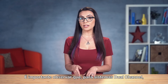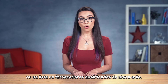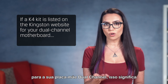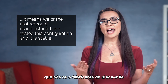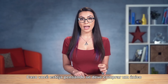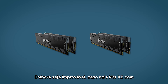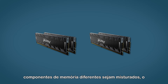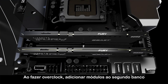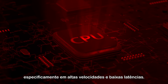It's important to note that for dual-channel systems, we do not recommend installing two K2 kits unless it's a verified configuration on the Kingston website or on the motherboard qualified vendor list. If a K4 kit is listed on the Kingston website for your dual-channel motherboard, it means Kingston or the motherboard manufacturer has tested this configuration and it is stable. If you're deciding on whether to buy a single K2 kit now and maybe another one later, Kingston recommends the K4 kit since the modules in the kit will be identical. While it's unlikely, if two K2 kits with different memory components are mixed, the overclock might not engage or it might be unstable. When overclocking, adding modules to the second bank of sockets of a dual or quad-channel system places a heavy load on the CPU, specifically at high speeds and low latencies.